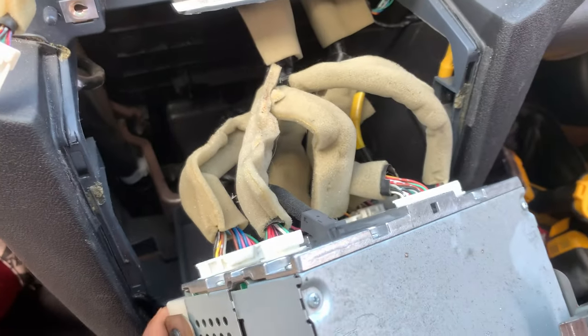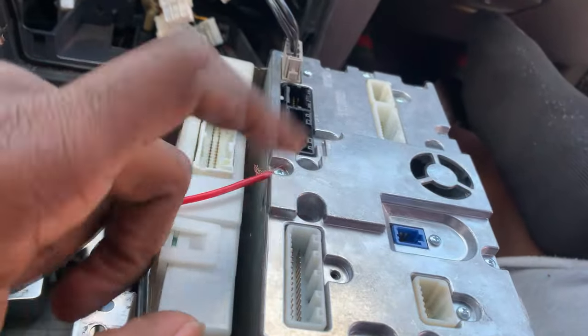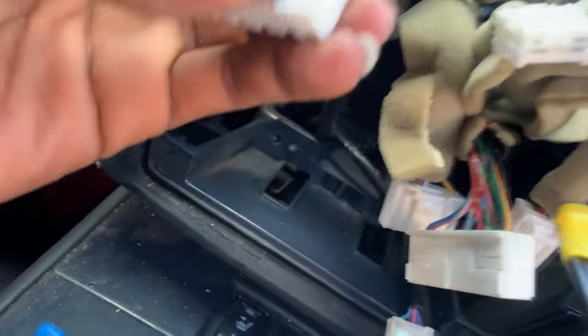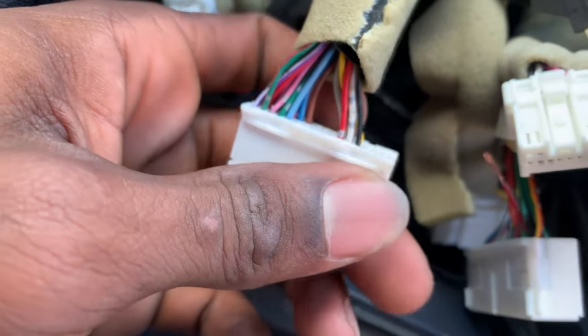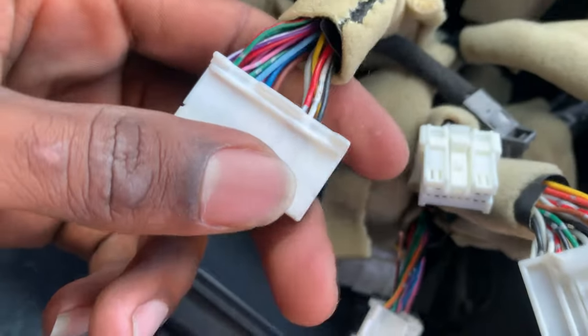I've got the radio removed. I already did an extra step — I went and got a little wire and attached it to the back of the radio, because what we're going to do is attach this wire to the ground wire for the parking brake in the harness. The harness we're going to use is a smaller harness towards the left side of the car — it's going to be this wire harness right here. You can compare it to this one: it's going to be a whole bunch of wires, a gap in the middle, followed by more wires. It's your kind of middle-sized harness.